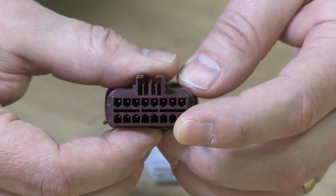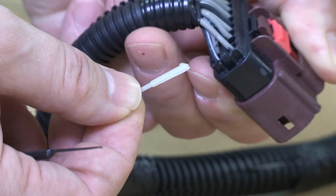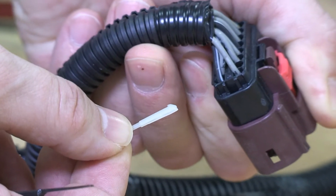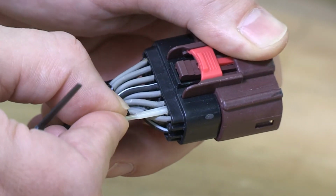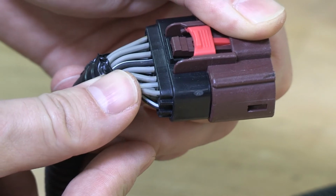The hook feature is intended to lock into the connector just like a terminal. The cavity plug has a raised ridge along its spine opposite the hook feature to help ensure it is clocked correctly in the opening. Line up the raised spine on the cavity plug with the channel, with the hook side inboard. With the TPA removed, push the cavity plug in.